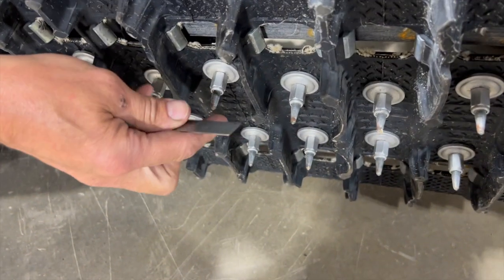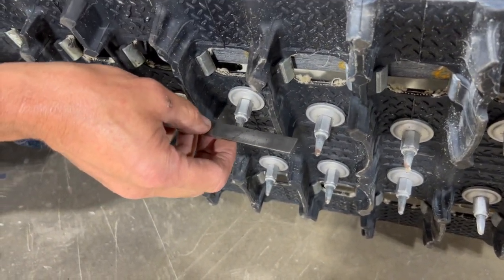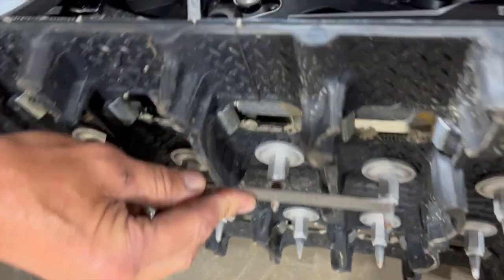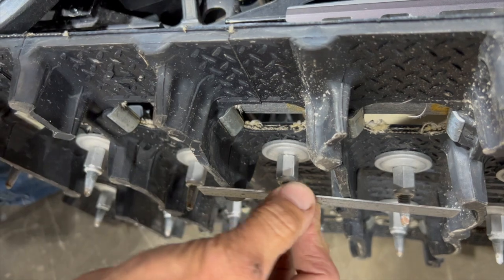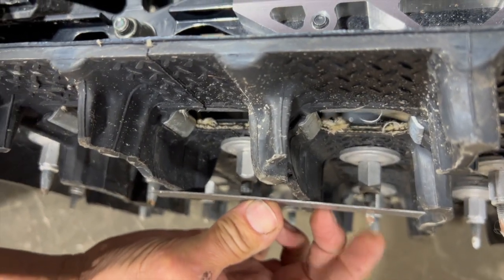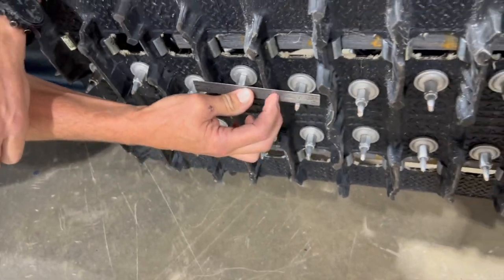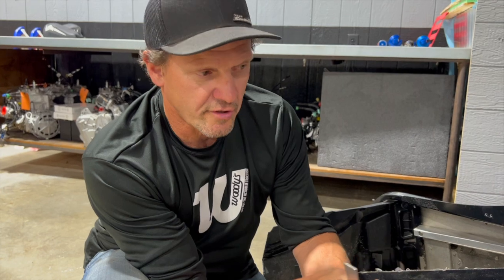So it's a little weird, people think, well, why would I use that? Because it's only just a little bit longer than that. But when you look at this, this track has 2,600 miles on it with these studs. So right now, you're a heavy 1/4 inch right here, and they've been worn. So when these were put in, they're basically that 3/8 out again, right at that tip. So the size of stud to track is very important.